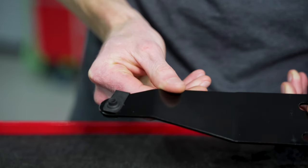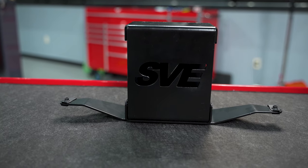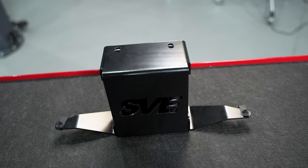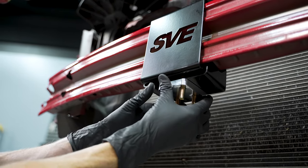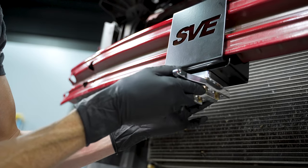To install the splitter brackets, first install two of the provided speed nuts over the outboard holes with the nose facing up. They are side specific — tell which is which by installing them so the bend ramps toward the crash bar and the flat edge faces front. Now install the spacer plate with the radius corners facing front. Hold it with your free hand and then install the receiver plate in the desired location with the machine groove positioned down.